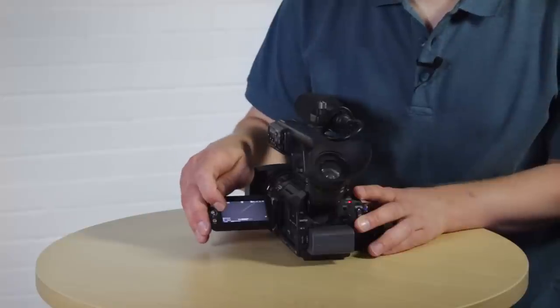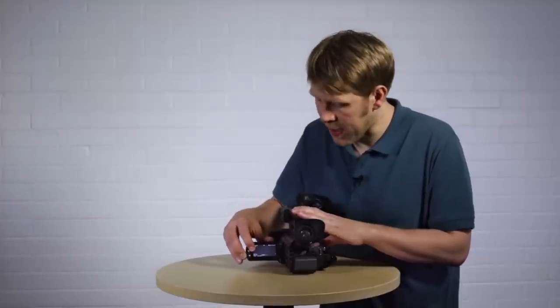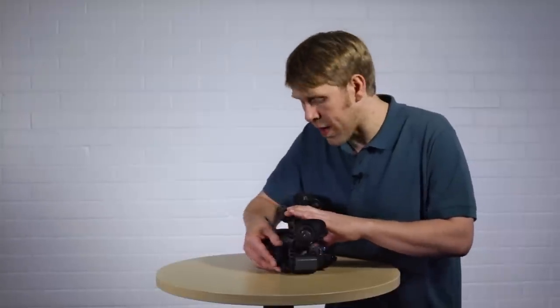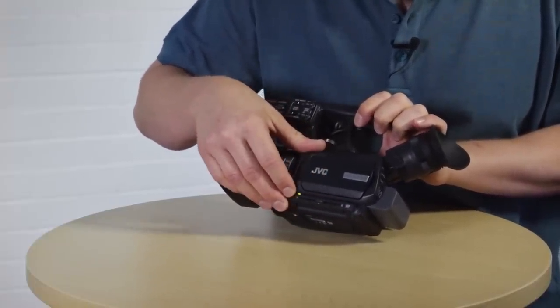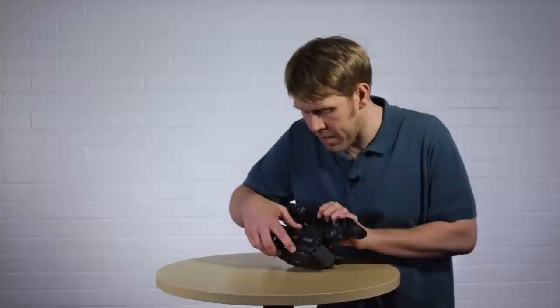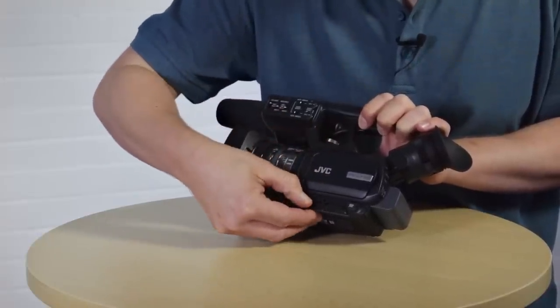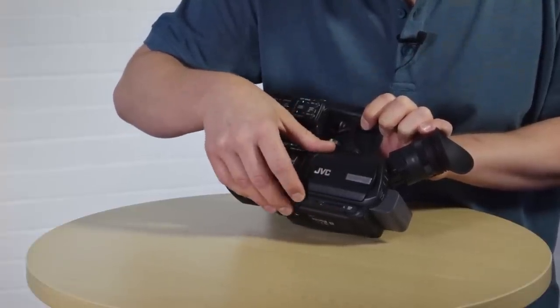Above A and B you'll sometimes see the word 'dual' or 'backup', which tells you which slot mode the camera is in. Most of the time you won't see anything there, because the camera will be in series mode — the default. In series mode, if you have SD cards in both slots A and B, it records to slot A by default. When slot A is full, recording transfers over to slot B. While recording to slot B, you can swap the card in slot A for a fresh one, and when slot B is full it transfers back to slot A — this effectively gives you unlimited recording time.